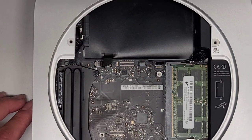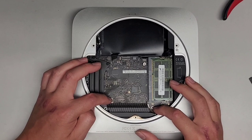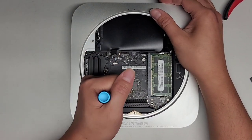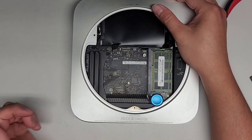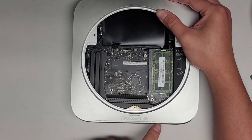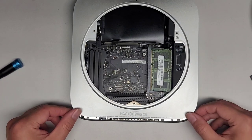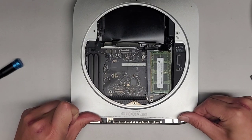Let's zoom out and show you how we pull out the motherboard. There are multiple ways — there are tools you can use for these little holes here with the silver. You could technically use two screwdrivers to pull it, or you can use just one screwdriver like this. As you can see it pops slightly forward. Then you can go over to this side and pull this as well. You can see it popped more forward and we're just going to keep slowly walking it out.